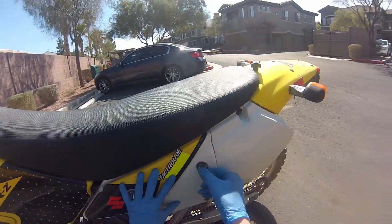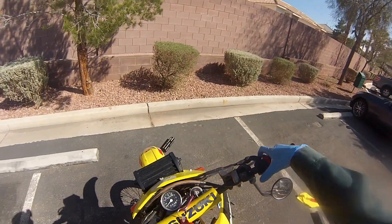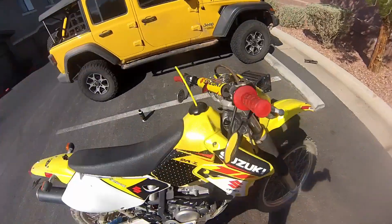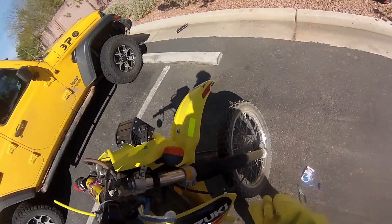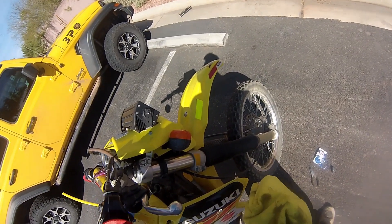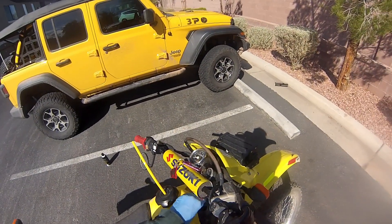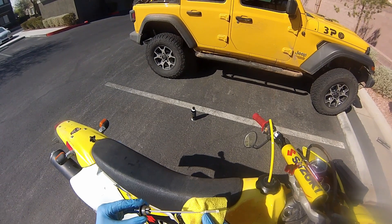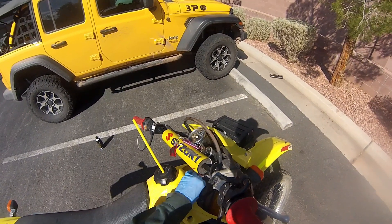I hadn't started my bike in a while — about four months — so I used a little bit of starter fluid just to get it going. It started right up. After warming the bike up, I let it run at least five minutes to make sure the oil is hot and flowing into the frame, because that's where the dipstick is. Don't screw the dipstick back in when you're checking — per the manual you are not supposed to screw it back in, just stick it in and pull it out and check it. I'm sitting right there at about 95%, which on a hot bike is perfect.